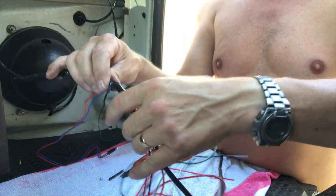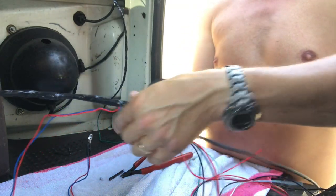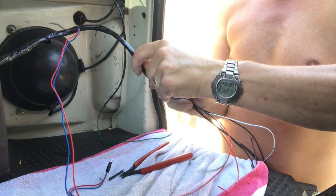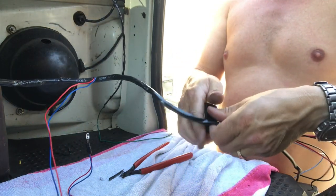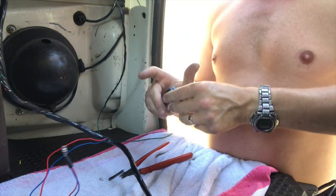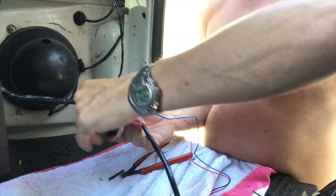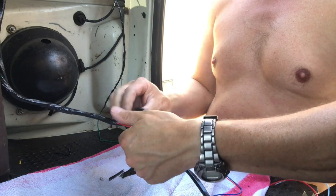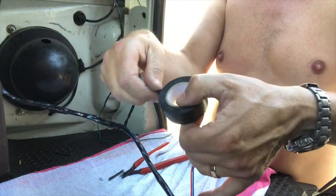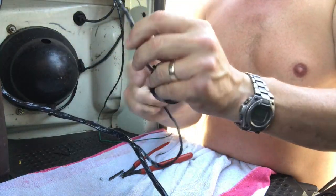Getting across now — I've just brought off the two wires for the LED; I'll come back to that in a minute. Just tape up enough to get me across to the side of the van. The taping of the looms is what makes it look nice, what makes it look a neat job. If you can do this before you actually strap it into the car and get everything about right, it's going to look much neater than if you tried to do it while it was all in place.